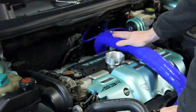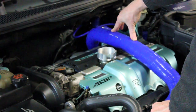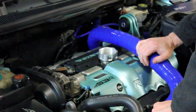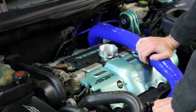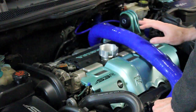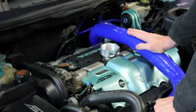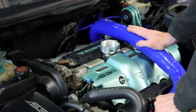On the turbocharged cars, the over-the-engine pipe comes over the top of the cover. In this particular case we have our new silicone high-flow pipe on here, and this pipe has enough flexibility that we can simply move it from side to side off the screws we want to, and I can do this job without too much hassle. On most of these cars you will need to move this pipe to remove it from the top of the engine so you can get the cover off. That's going to involve different procedures depending on the years and models, so we're really not going to go into that in detail.